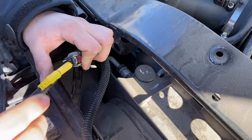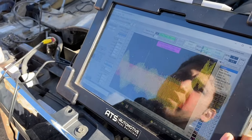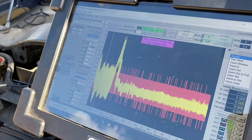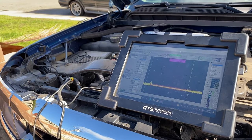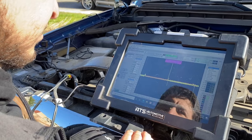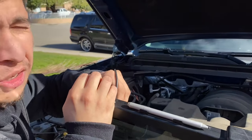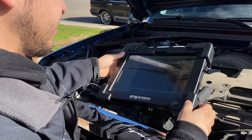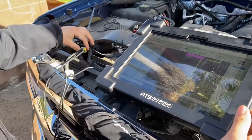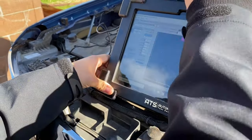Let's go ahead and look into our power — make sure we've got that. We're going to back probe into that, open up the scope, start recording. Let me go ahead and turn on the vehicle. I forgot to put in the ground — you've got to always get it from the battery for your scope. Battery ground. There we go. Now we've got our 14 and a half volts — that's battery operating voltage. Let's go to our ground now. We got a nice, pretty good ground there. No voltage drop.